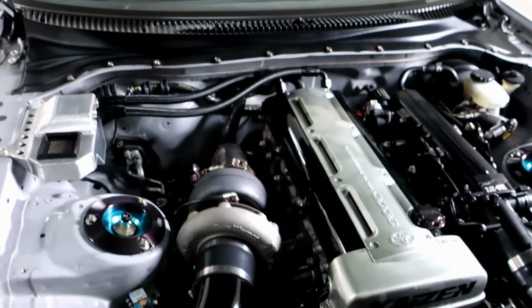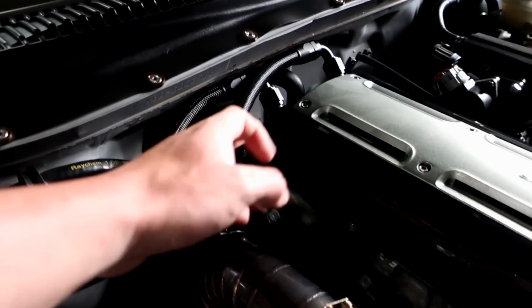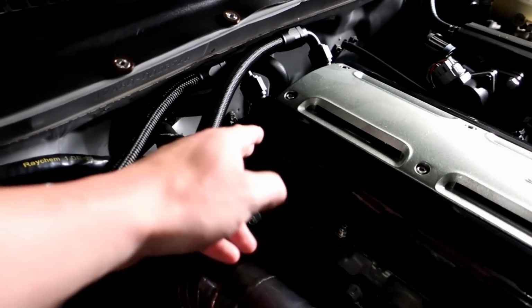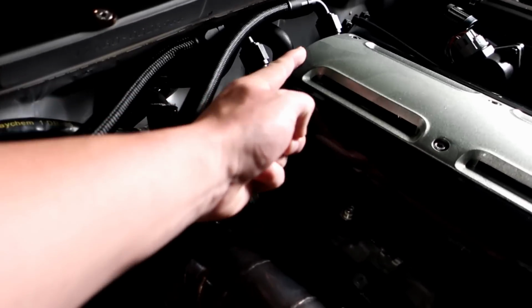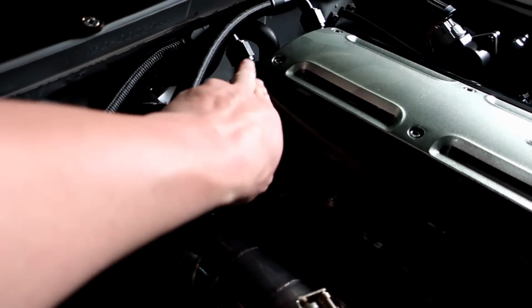So it said rear covers. Again, like I said, guys, it's more for looks. If I were to do it again, I would most likely keep the stock covers or get something where these fittings can be in the rear. They shouldn't be here at this angle, because when this oil sloshes back, it's going right into there. If they were sitting on top, at least if it was hitting the back, it can get sucked against there, but it's not going to go right through the lines.